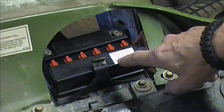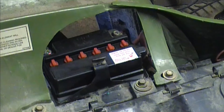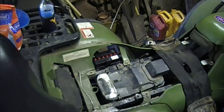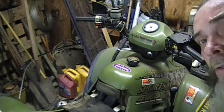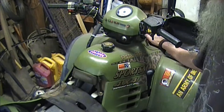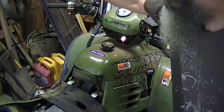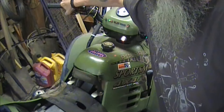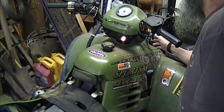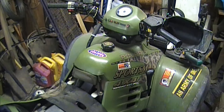Here is the battery in question — remember the red caps? I'm just showing you what it looks like now. It's in this ATV machine here. I'm going to turn on the key. You can see the lights work, but when I hit the starter, that's all that battery will do. It's got a little bit of charge in it because I've been charging it overnight, and that's what it's got.